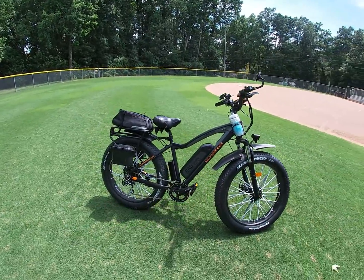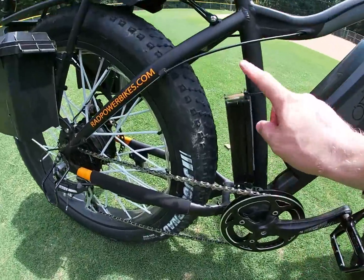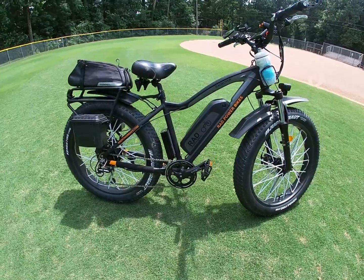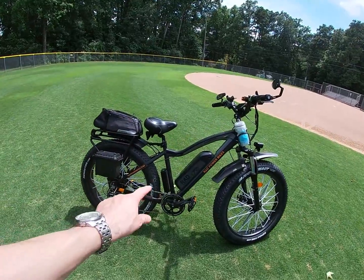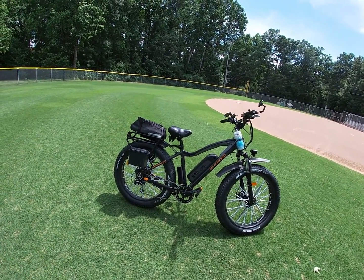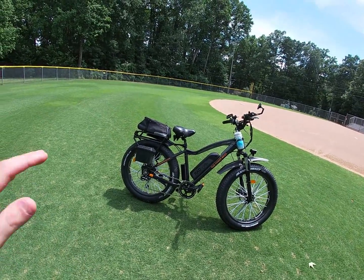As of right now, there's a lot of extra accessories and stuff on here, but performance and drivetrain wise, the only thing I have changed is this right here. I got this controller from Bolton e-bikes. Pretty sure he's out of stock on them now. You could probably find another 35 amp controller on some other website. Just make sure it's got all the plugs and everything that fits a Rad. That's the only thing I've changed, and the performance that I got out of just that one change was very dramatic. This bike accelerates a lot faster, has a lot more power. No more top end speed at all, but it was worth the $219 or whatever I paid for it, for sure, just to get that extra acceleration.